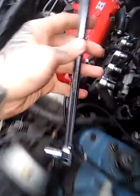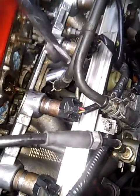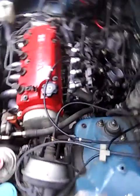They say you have to go to the bottom. But I just got this breaker bar, moved all these lines out of the way, and wiggled it in there like this, right? Can you kind of see that? I got it on the nut and broke it loose, and then I just did it again. I did it like three times, and then I just stuck my hand in there and undid it. So I didn't have to go to the bottom.